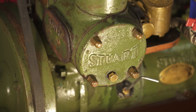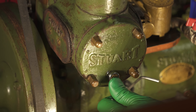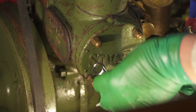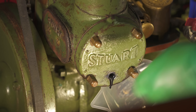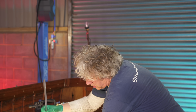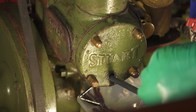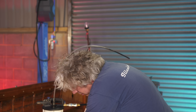While I'm here, I'm also just going to look at this little drain plug here — it goes into the expansion chamber for the exhaust. Because you've got oil in the fuel, there's a chance that we're going to get some collecting in here, so I'm just going to make sure to drain that out. Oh dear, look at the colour of that. There's not much, but I'll just get the old vacuum on it again. Right, so now we're happy with that. The next thing I want to think about is the ignition.